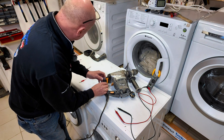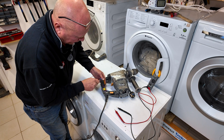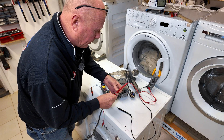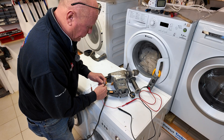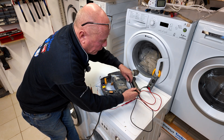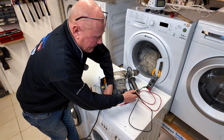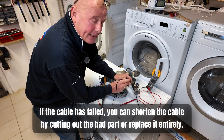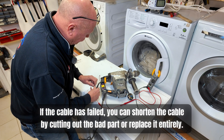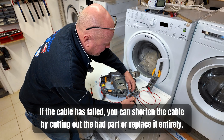I'm going to turn the multimeter to continuity - you can see the screen there - and we're going to check across the fuse. The fuse is good. Now we need to check the live wire and the neutral wire going through to the actual switch here. I'm going to lift the switch out and undo the two cables - the neutral is on the top side and the positive or live wire is on the other side. I'll bring these over and use my crocodile clip on this, connect that to the neutral, and check the actual continuity going through there. If you have an intermittent fault it's worth moving the cable at this point to see if there's any breakage in the circuit, because sometimes the actual copper inside the wire can fail internally.